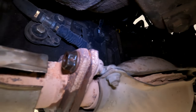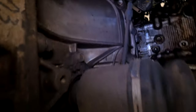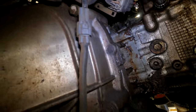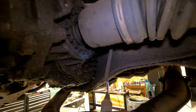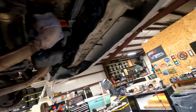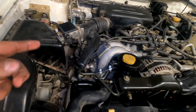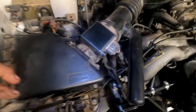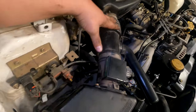There's an O2 sensor here, so reach up and unplug that clip right there — the O2 sensor will just come out with the pipe. In order to tilt the motor up without any issues, undo the clips on the air box so that the air box and this piece will tilt and not cause any binding issues.